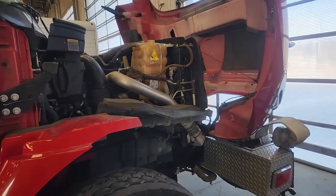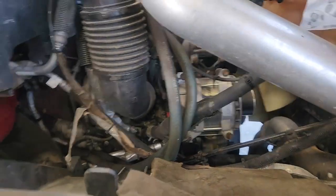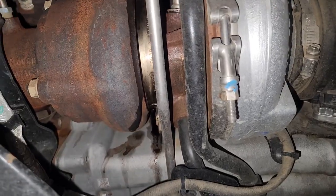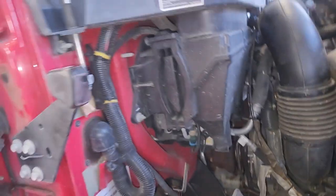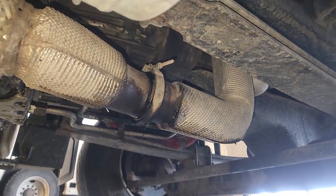I am not an international expert, and here's the problem: we've got no coolant in the coolant reservoir. There is coolant, however — traces of it — coming out of the exhaust side of the turbocharger. This is not good. Purple Pete had coolant coming out of the exhaust too, and that ended up being almost a full rebuild. This one is not locked up — I rotated it and it rotated fine. Although it kind of looks like oil, it's actually coolant; if you get directly over it, it is red.